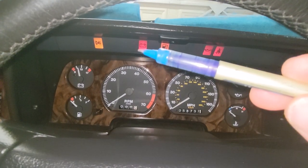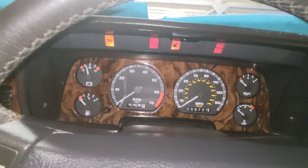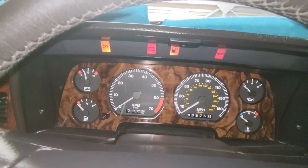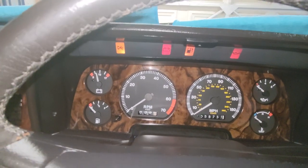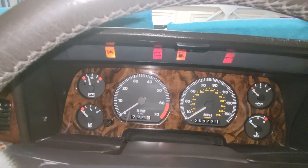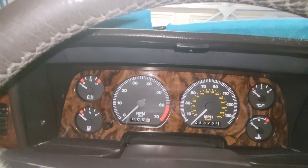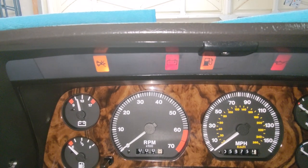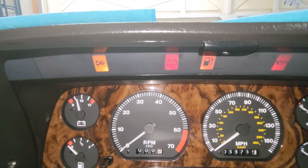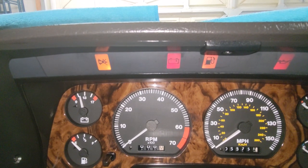So, you see no ABS light. And about now we should get one, two — a gap — and one. So that's your first code: 21. You're going to have to wait about six seconds and see if there's any other code. So 33, 33. We'll just wait and see if there are any other codes after another six seconds. No. Okay, so we'll just do that again just to confirm. We should have two and one — yep, there's 21. About a six second gap. That's three and three. Yep. 21, 33.